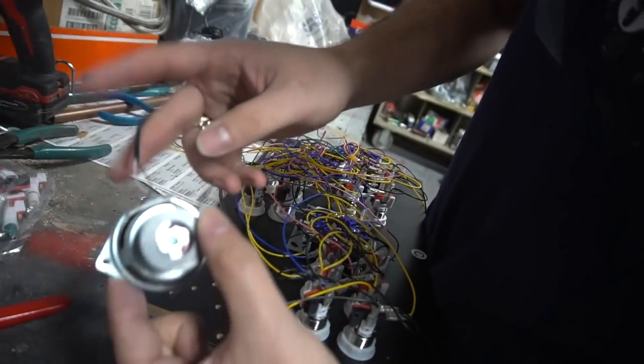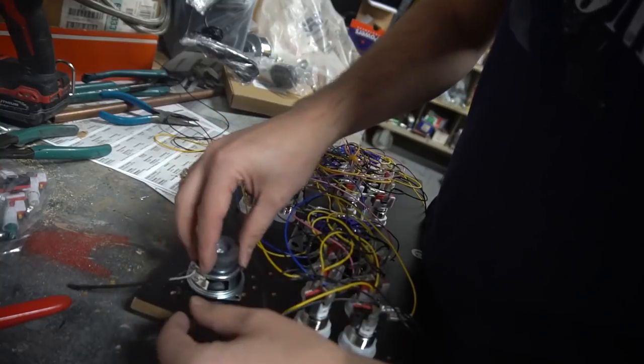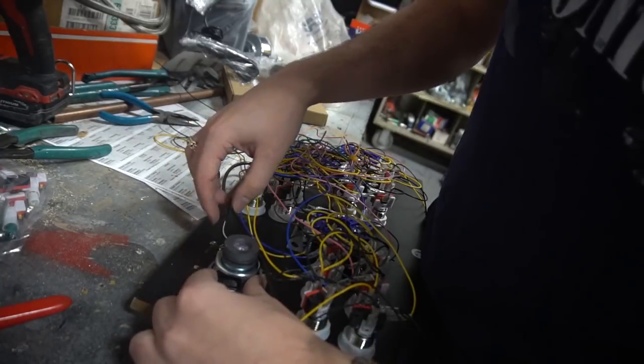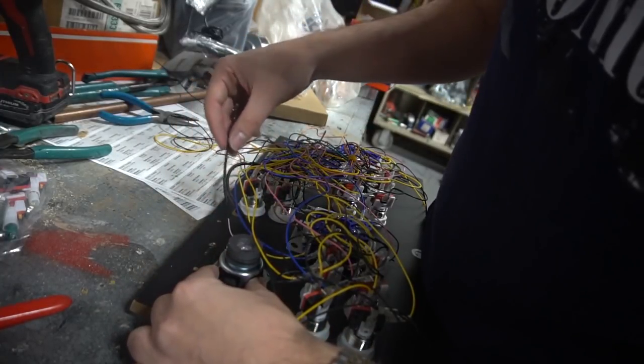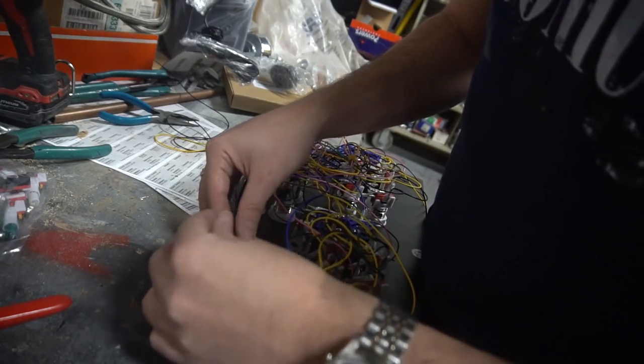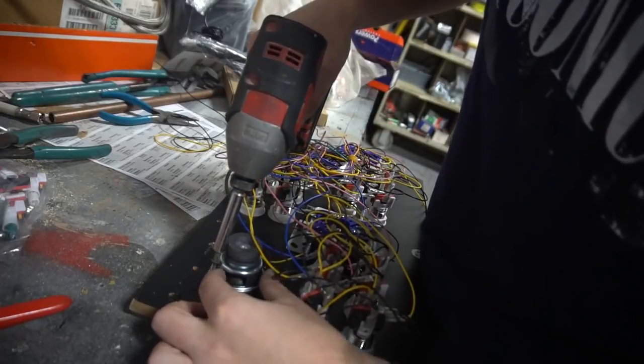Notice my wiring. My wiring is going inwards towards the controls, not outwards. I'm not going like this, or else you're going to hit the screws. It'll squish the wire. We're going outward, inwards to the wiring, okay? And basically, you just want to try to aim for the center. Once you have the center, you're going to take your screw, use the holes on the speaker,